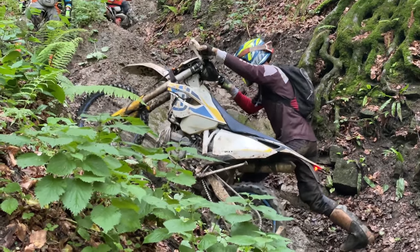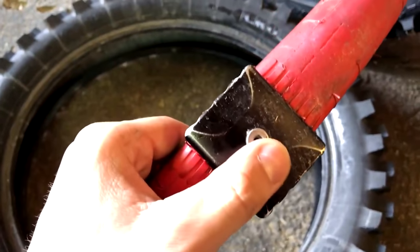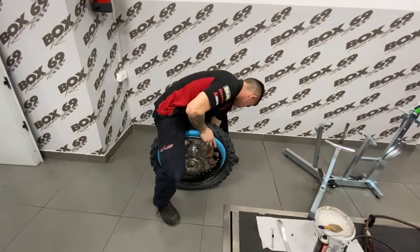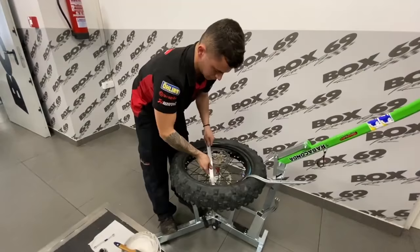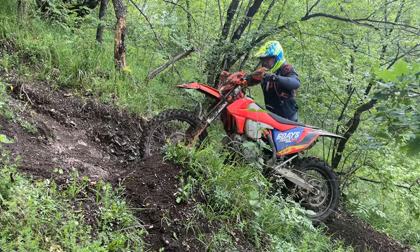The tubeless system is similar to the mousse, but instead of filling up the tire it acts more like a rim lock and seals into place. Like the mousse, it eliminates the need for a tube, but unlike the mousse it allows pressure changes as low as 0.2 bar on certain tires, and is most often used in the 0.3 to 1 bar range. It resists tire punctures — it's like a bulletproof vest for your tire. The downside is the expense and the work involved in installing it.